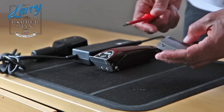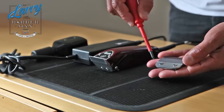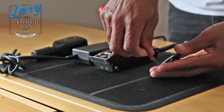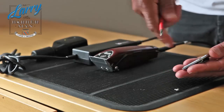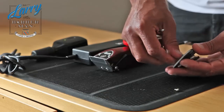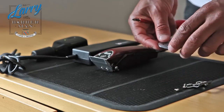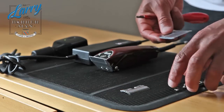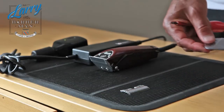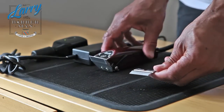What we need to do now is detach the cutting blade from the cone blade — very easy job. Just undo these two screws and it'll just fall apart. That's one, two, and as you can see the cutting blade that you need is right there. The rest of it just becomes redundant; you don't actually need that anymore, so we'll put that to the side. That's the cutting blade from the Oster 76.